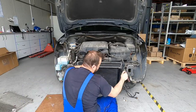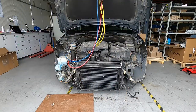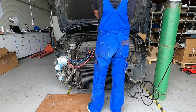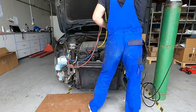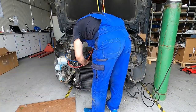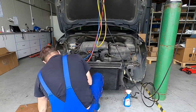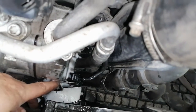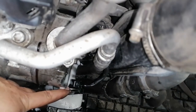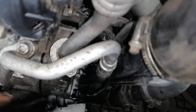It's time to put back the radiator, which is mounted in front of the intercooler radiator. First, before putting everything back in the car, we will do a pressure test - a short one. We will just use soap water to see if we can see any bubbles on the places that we have worked.